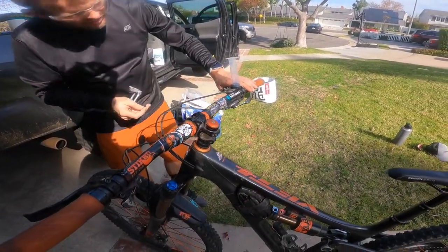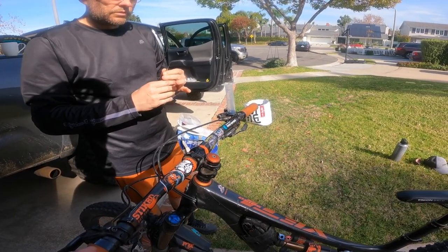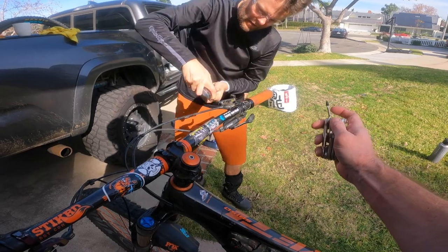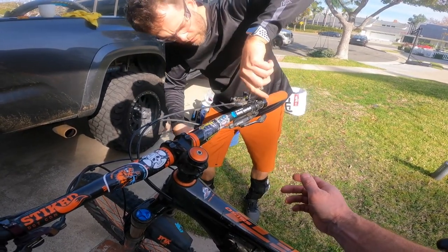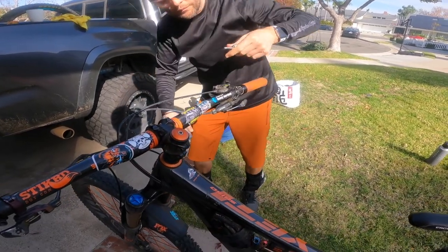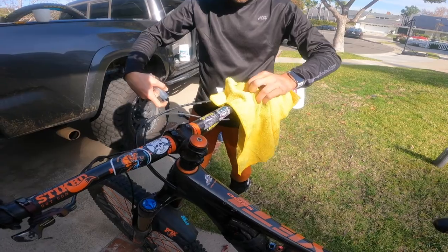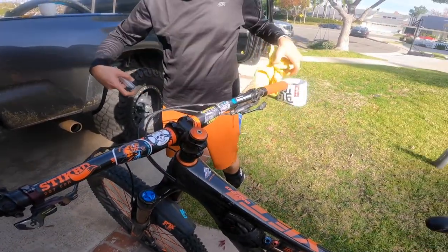The last thing we need to do with the lever level is to make sure we get this in without introducing any air. Usually I set it on the bench just like that, but I'm going to pull this out and put my finger over the end. There's a little bit of oil there, and as I put this in it's going to displace some of that oil and run down — which is normal. That way you know no air got in. These just go snug — don't strip those because those are plastic threads on both ends. This oil is gross so I'm going to throw it away, but if it's not gross sometimes I'll keep it for another bubble bleed.